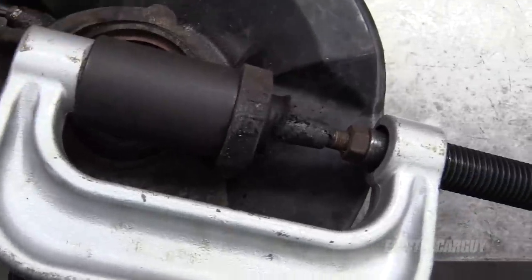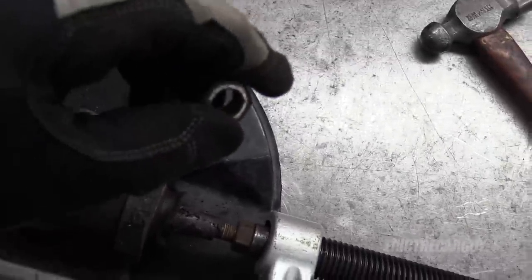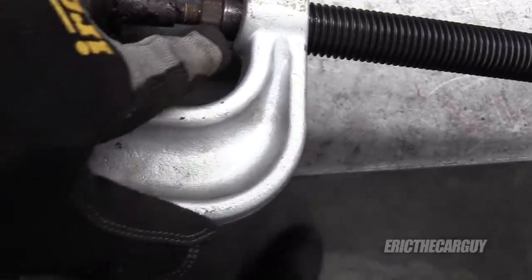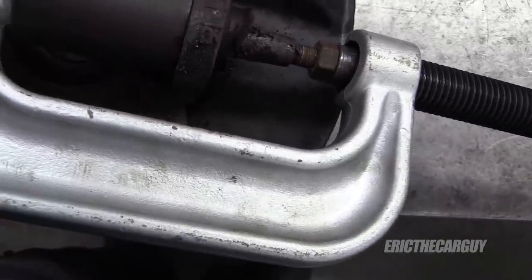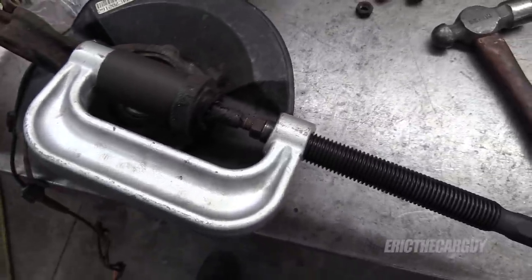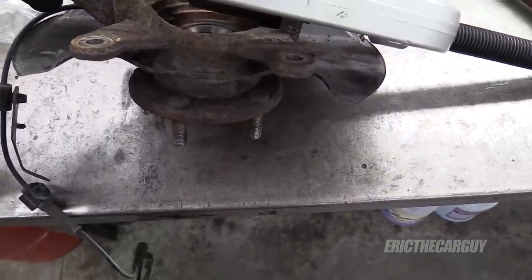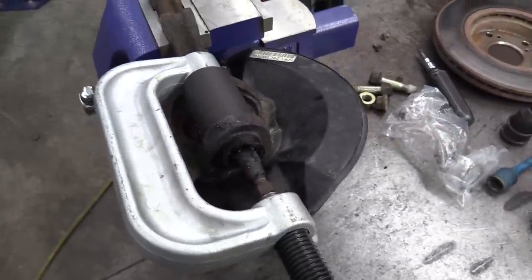So far this is what I've come up with: I've got the same receiving cup that I had when it was up on there. I took a nut from the tie rod ends — I've got new nuts anyway — and put it on the end here. Part of the problem was it would compress and move to one side or another. I'm hoping since these two things are the same size and that this end also rotates, it helps push it through. To make things easier, I'm mounting this up in my vise to help hold stuff in place. I'm hoping I can show you how to do this without having to buy the whole assembly.